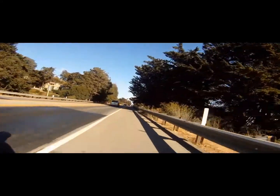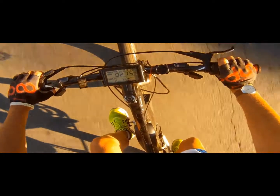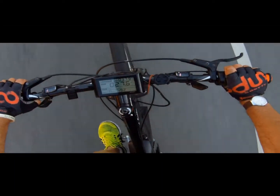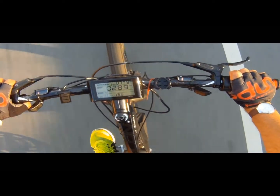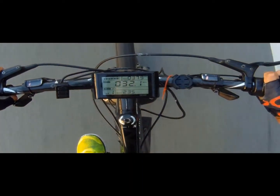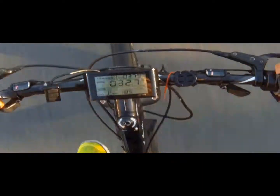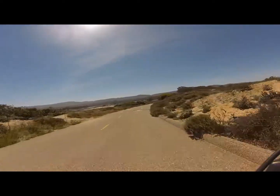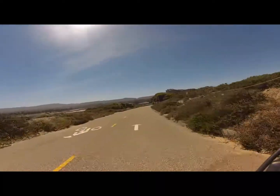One of the things to consider when you're looking at e-bikes is the battery — it's critical, it's your gasoline. In my case I have 840 watt-hours, which is 48 times 17.5. If you divide that 840 by 20 — the 20 being that you lose basically 20 watt-hours per mile — I can get 42 miles just using the throttle on that battery. But I'm using pedal assist most of the time, so I'm getting between 60 to 80 miles per ride.